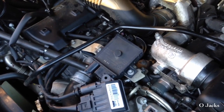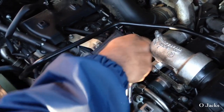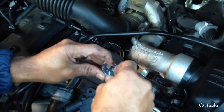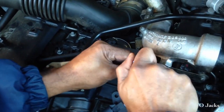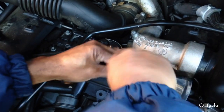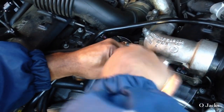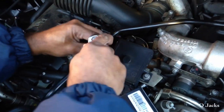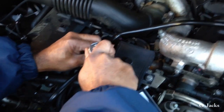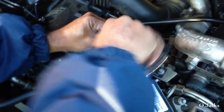I've got to pull the old one up because the old one has some issues — it'll give a false reading like the glow plugs are bad. People have been changing all the glow plugs and the check light still comes on. So change that module.